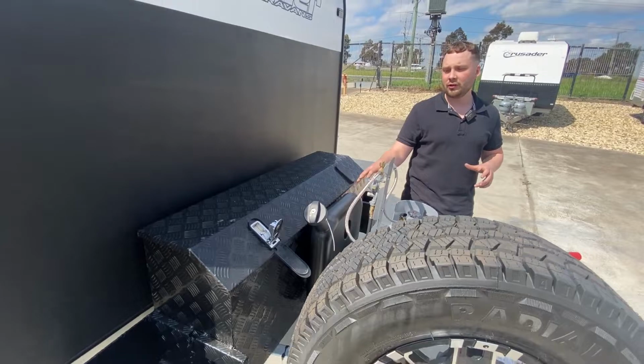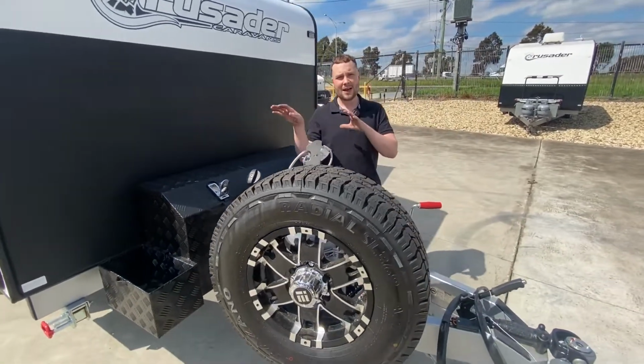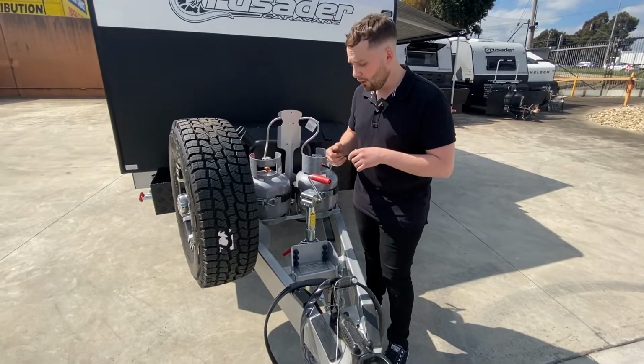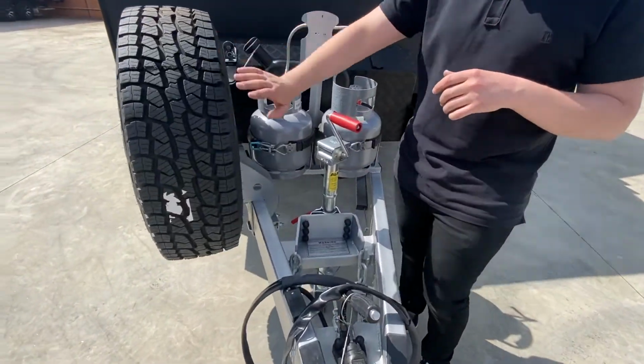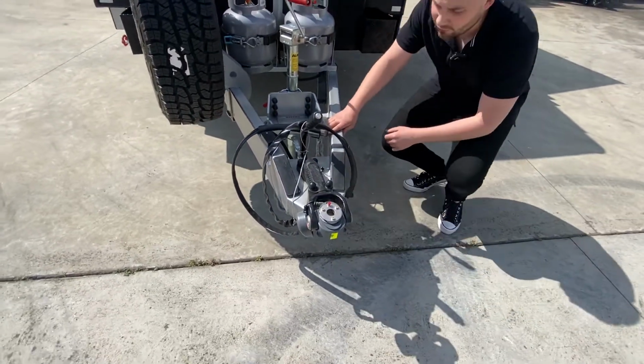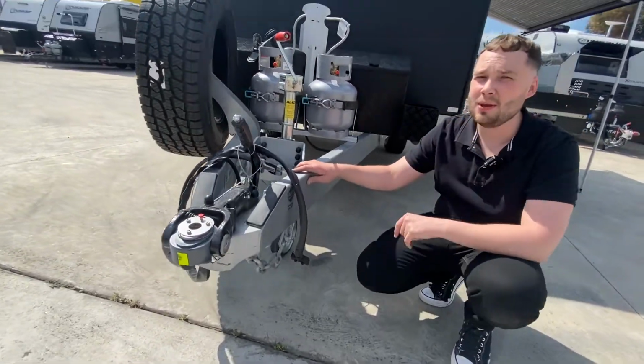It's a 2 kilowatt system from Diesel Heat, mounted underneath the bed. It heats the van in about 2 minutes. It's unbelievable. We've got the front rotating jockey wheel. We've got a spare wheel here on the front with the signature Intel Engineering chassis. We have a chassis by Intel Engineering. This is a 3 millimeter, 450 MPa grade of steel.